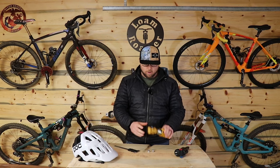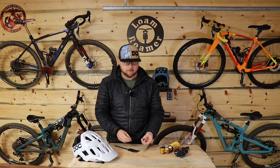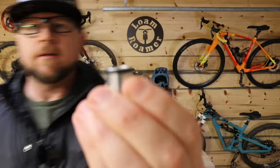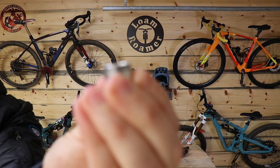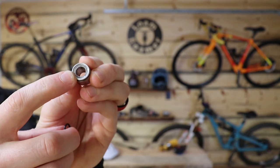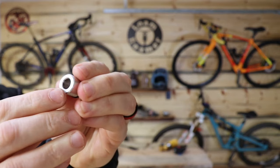What you want to use is the Ohlins spherical bearing kit — I'll put the part number in the description. What you won't be able to buy are these caps right here. These caps are custom — Mike had them custom machined. They've got the O-ring system nicely installed here. You can see if you take these off there's a nice groove in there. Everything is machined well, and the surface is actually conical so that it butts up against the spherical bearing and sits there nicely. You've got a really nice groove here for the O-ring to sit in, and everything is managed really well.